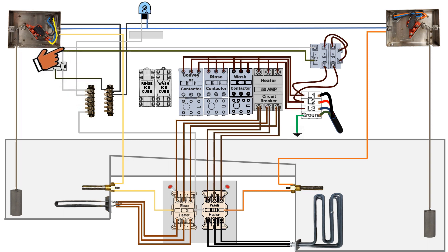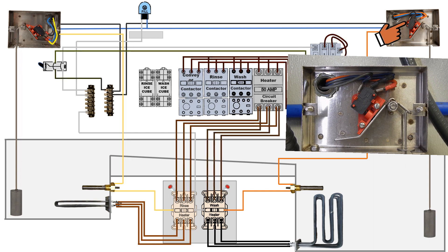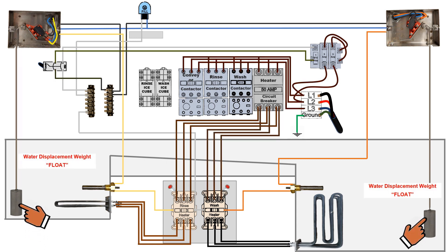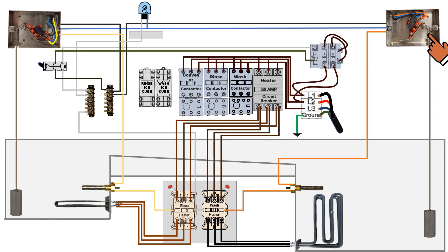From the top side of the control terminal, a black wire wires into the rinse float switch. A separate black wire wires into the wash float switch. These are so that the switches can operate independently. In the wash and rinse tanks are water displacement weights, or better known as floats. Water displacement weights are connected with rods that go up through the machine to the float switches. They control a lever that changes the direction of the micro switch.